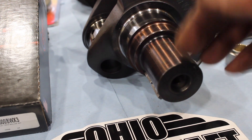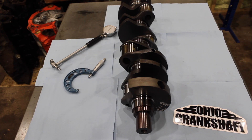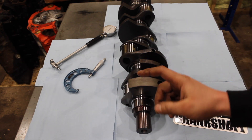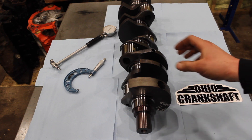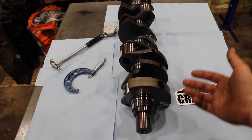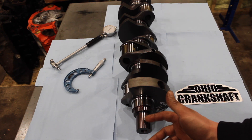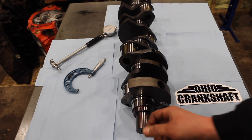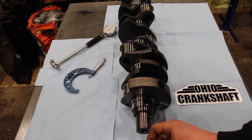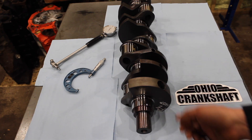I just wanted to show you guys something cool you don't see every day — a small block Chevy crank with a big block snout. It's a very smart idea if you're running a blower-driven application, or even a centrifugal blower. Blowers put a lot of stress pulling upward on that small little snout, especially when you're running that little shaft on a small block Chevy. So if you're doing a blower motor, it's just a good idea.